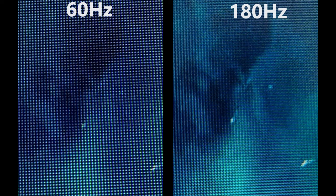You also have to consider dynamic interlaced pattern artifacts, where shades appear to break up into a very fine polygonal mesh during movement or if you move your eyes across the screen in a certain way. It couldn't be captured on camera, but it occurs regardless of refresh rate or VRR status. Even at its worst — which tends to be at lower refresh rates — it's quite faint and not something most people will notice.